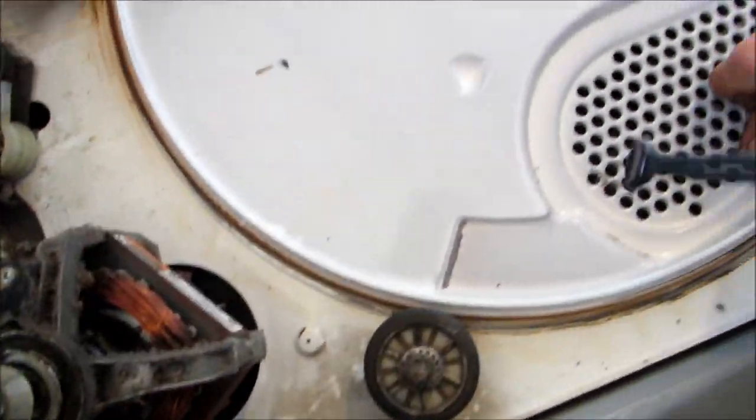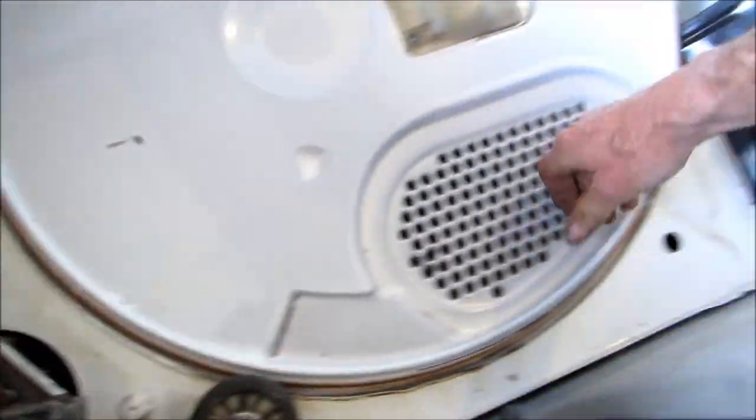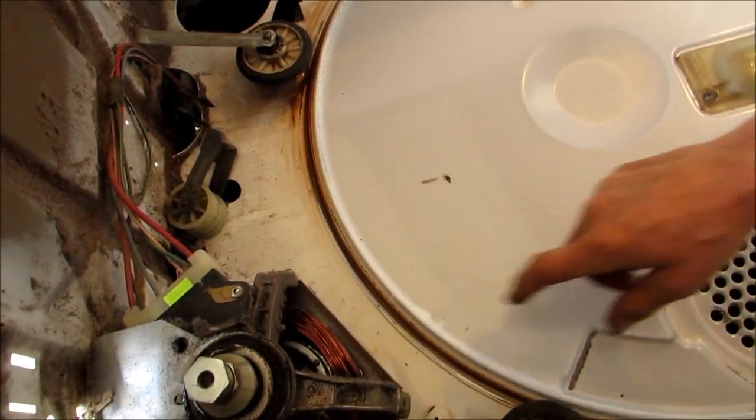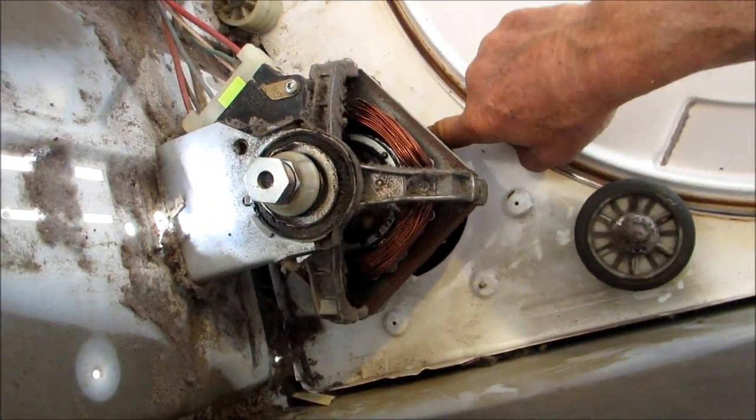And we've got some coins that dropped. They got back in the chute. Something fell down the chute. It's typical. This is the dryer with the vent chute on the top of it. And things fall down this vent chute and then get caught in a blower housing.